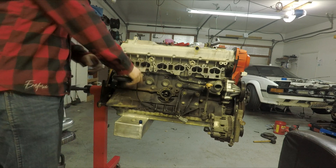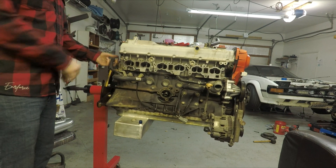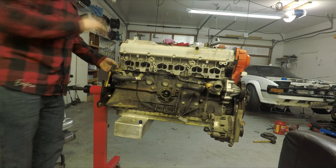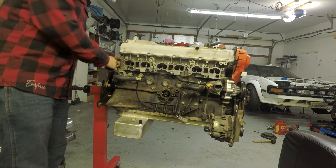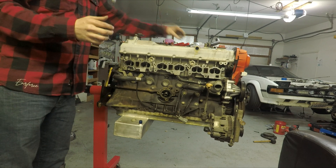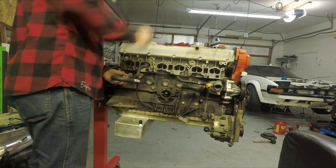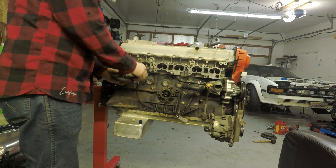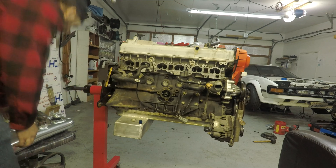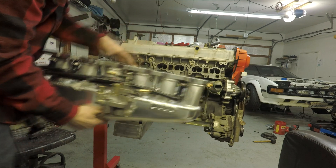All right, so I got you guys set up here. I got a couple lines - the old line that I explained to you guys, where I was running my turbo drain from. This thing was routed up and around and through and up and down. I cut it up and now we have all this extra tubing, and we are going to use this to route our lines. We're gonna put this one here - this is gonna route essentially up and over and in. My idle air control valve is on the bottom of my intake, and we're going to be running into this line first.